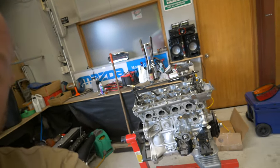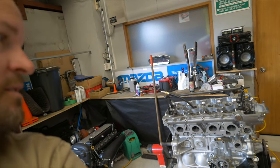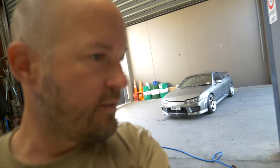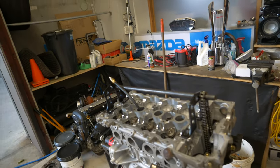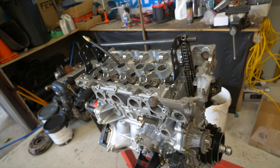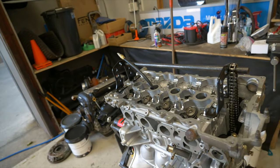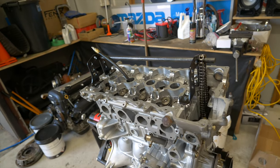It's a new day. Ben's been busy — not filming things — putting the head on, some valve springs, we've got some pong cams for it, it's got a metal head gasket now. It's going to look pretty damn cool. This head, for some reason somebody had taken all the VCT gear off, it had aftermarket cams and they were massive. But we're going to put VCT all back in.